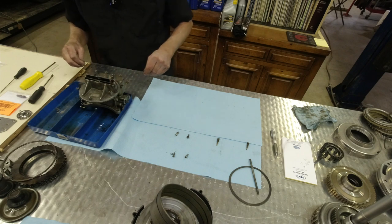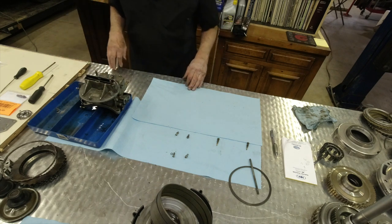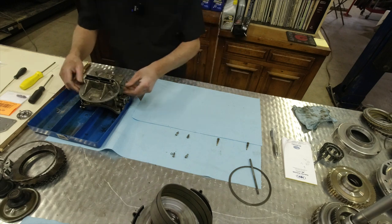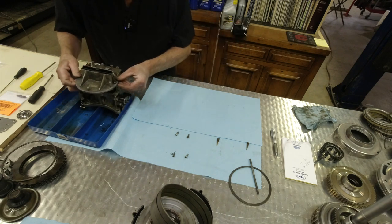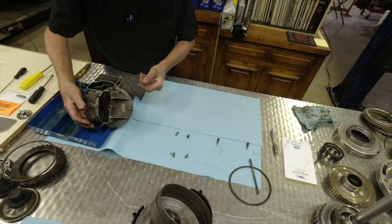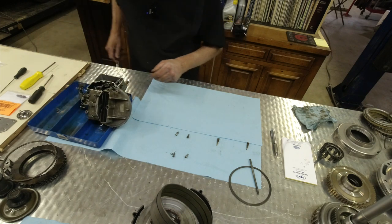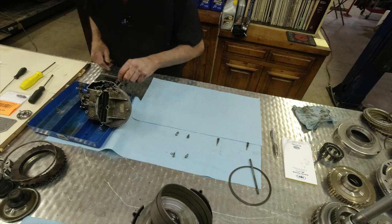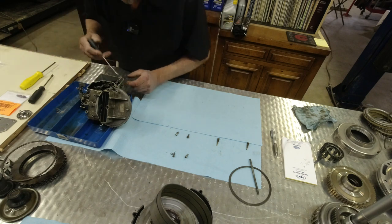Living in the Wood River Valley, where we had a lot of Jeeps, the Ketchum Cadillacs, a lot of your Fords, I'm very familiar with this carburetor. What we want to do is remove the top, kind of get that out of the way, and let's see this float. It feels heavy. So that could be the whole problem. Very, very heavy.